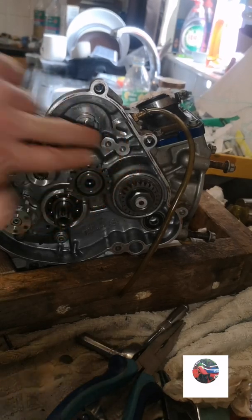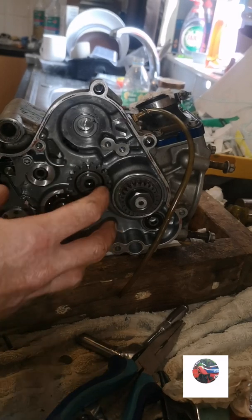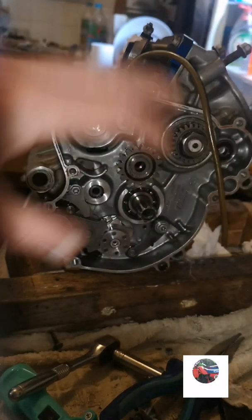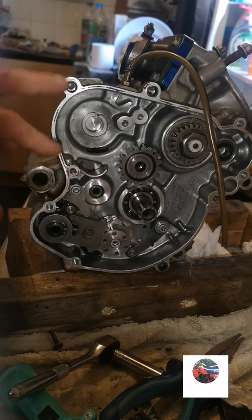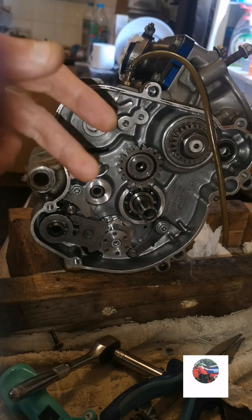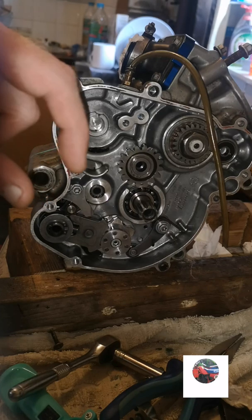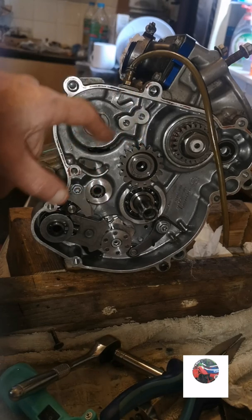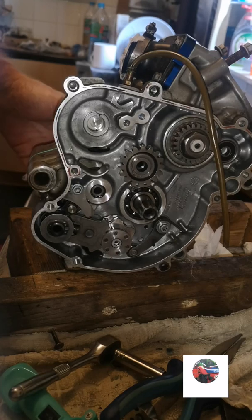Next, it's going to be the Kickstart Shaft. Fit the two locking plates over there. And the clutch basket. We'll get the Kickstart on now. And now just before I fit the Kickstart in, go through the gears, because it's still have that dodgy third gear idle cog, but I did file some of the sharp edges off, like some of the teeth were stretched with a bigger gap in there, so it just might be noisy in third gear. But anyway, go through the gears.